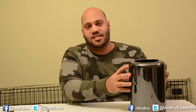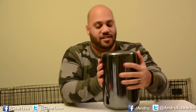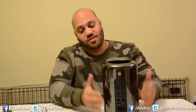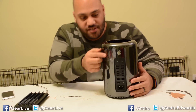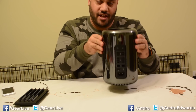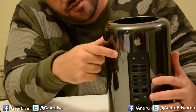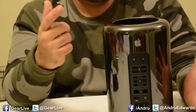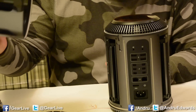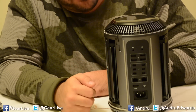In 2013 and beyond, they're going to stick with this design probably for a few years. So let's go ahead, open it up. I'm going to turn it around so you can see the back — that's what you're going to want to have basically in front of you. This is your lock. So if I lift it up right now, as you can see, the whole thing comes up. If I move this to the right, now when I lift here, the top comes off. I can put it aside and I'm free now to start upgrading the RAM.